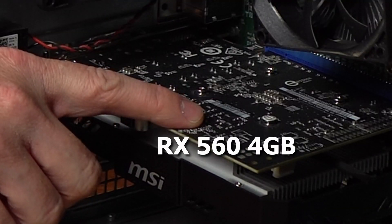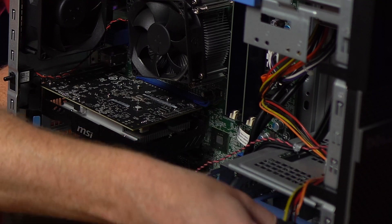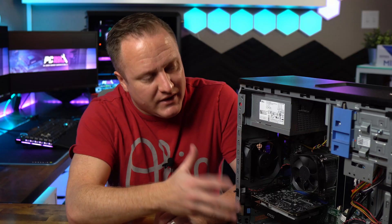Before we get into part hunting, just a quick overview of what we got here on the table. Check out the video of this particular build in its current state that I've done previously. What we have here is an RX 560 that we bought for about $80 on eBay as our graphics upgrade to allow us to do gaming. The good thing about that card was that we didn't require any external power, so that is something we'll have to address as we do upgrades here. Additionally, we also added a 512 gigabyte SSD.